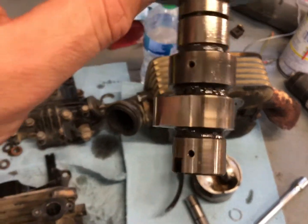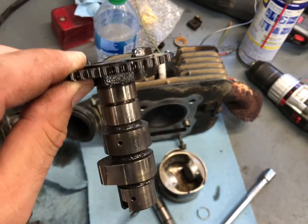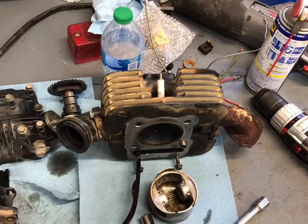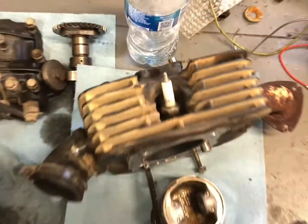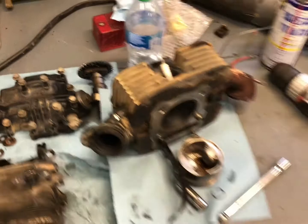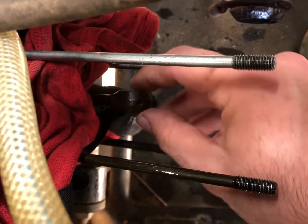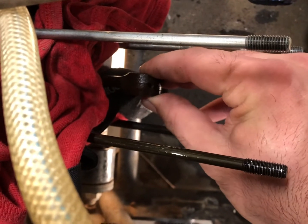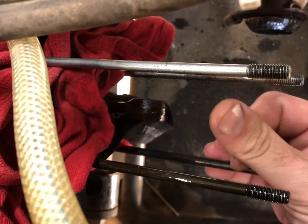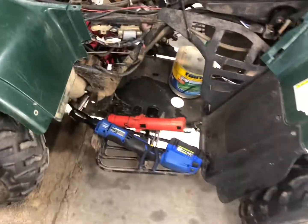The cam looks fine. Don't see any real bad wear on the cam journals. If it were to have been starved of oil, these galled pretty quick, because they're riding in this aluminum cylinder head. There are a couple little scratches and things in it, but it's not galled like it's been run out of oil or anything, so that'll be fine for a lot more years. Rods will always have a little side-to-side play. This one might be a little excessive, but you really have to measure it at the bearing with feeler gauges. In and out is what you're concerned about mostly — I'm pushing this way and then pulling back and I don't feel any play that way, so I'm thinking we should be fine there.